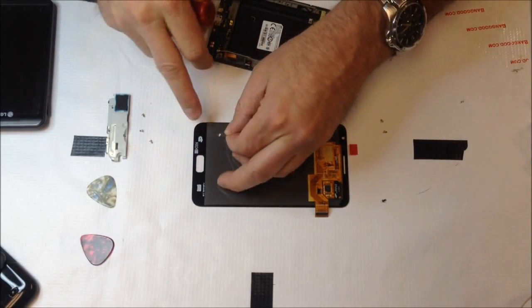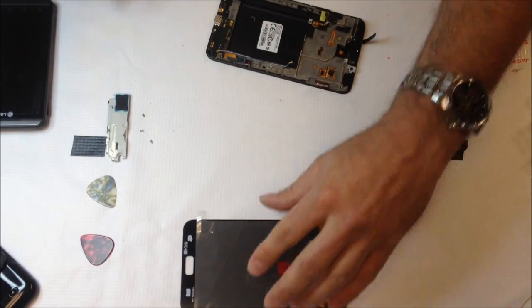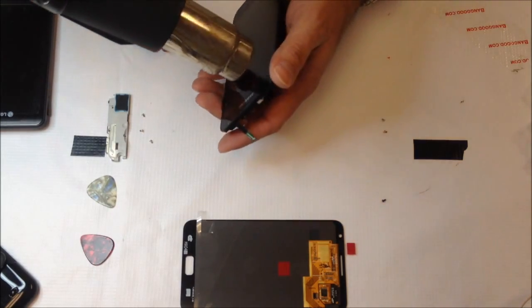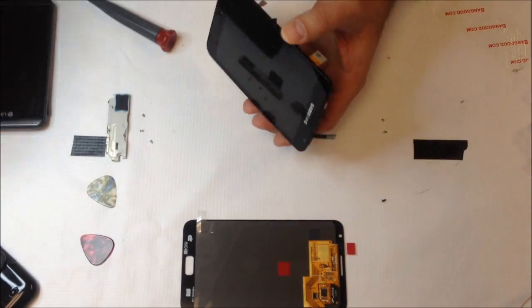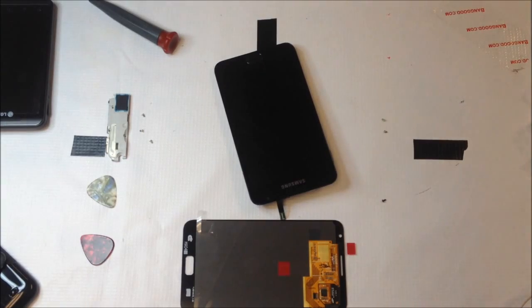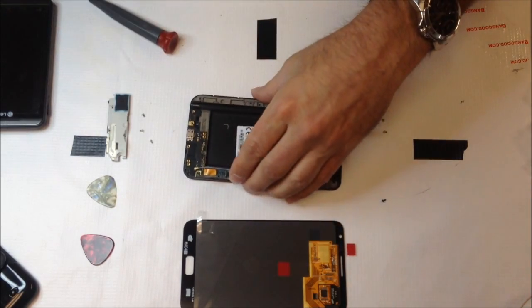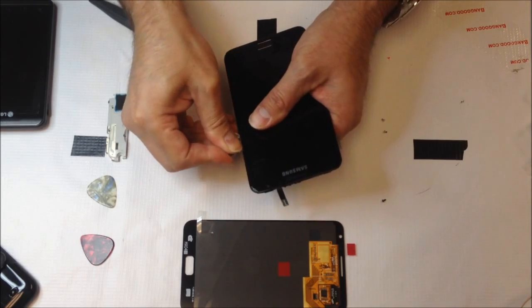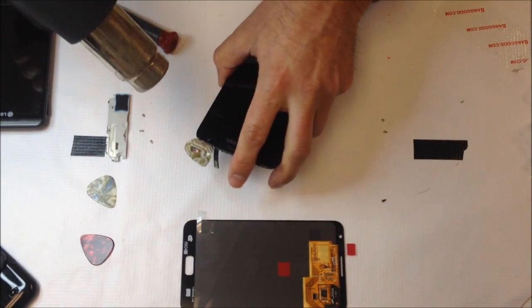Be very careful with the buttons. There's no adhesive on the replacement unit — it's all on the mid-frame, so this is just a soft rubber piece underneath that helps cushion it. Keep in mind Samsung likes to put adhesive underneath that bottom row of keys on the touchscreen — your home button, back button, menu button, etc. Those things can often have a flex cable that's adhesive to the glass. If you don't get between those two parts, you can easily tear that cable on the bottom. Anytime you're working with a Samsung Galaxy or any Android device with those bottom keys, be very careful when prying.